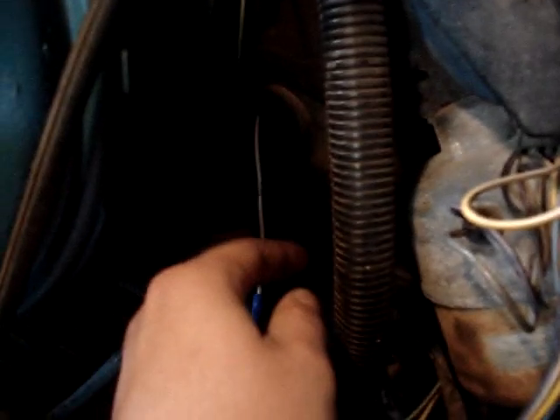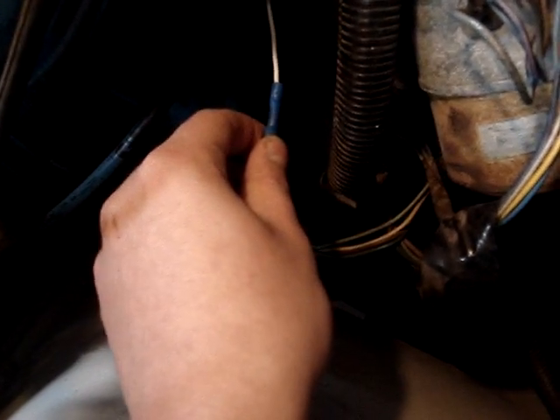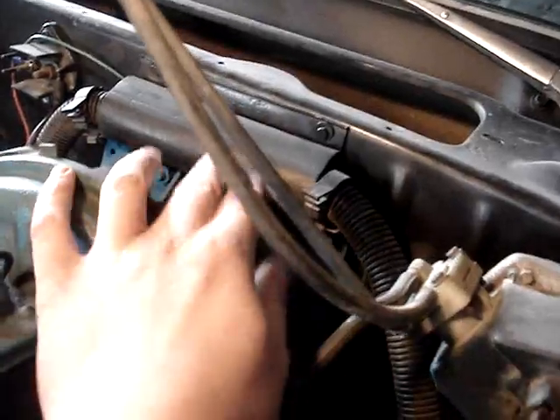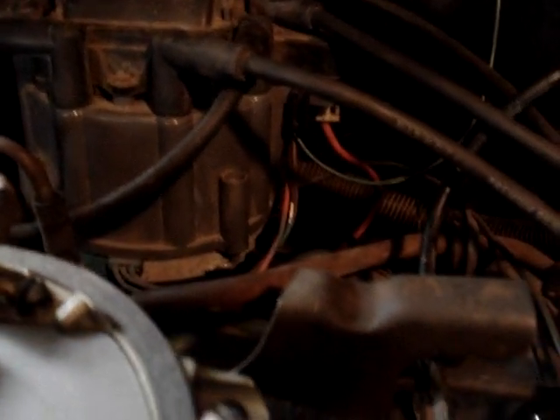Now I'm under the hood of my Chevy truck. This is the wire that's hooked up to the tach — the white wire I just showed you. I connected it to a green one, just in case I sell the truck and they want to identify which one is the tachometer wire. This wire runs behind the ignition wire contraption and all the way to right in there — right to that clip, the one right behind it.